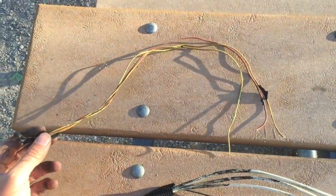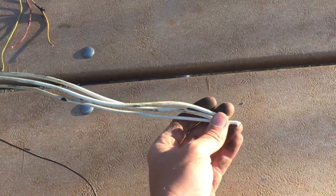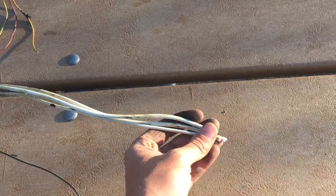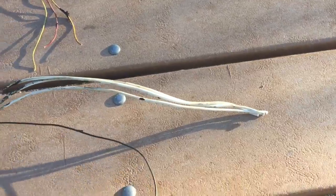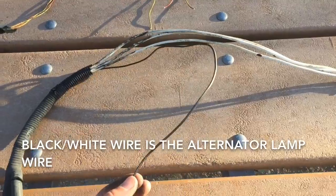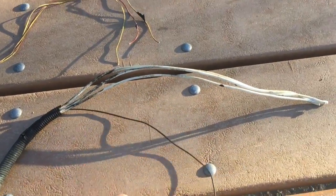With the protective covering taken off and the AC wires removed, what we're left with are the three battery connections. These will be tied together, and a large crimp will go on that, and then it'll install on the battery connection of the starter in a VW bus. Then there's the alternator wire — this black and white stripe — which will connect to the alternator or generator wire on the right side of the engine bay.